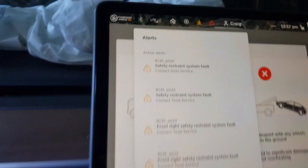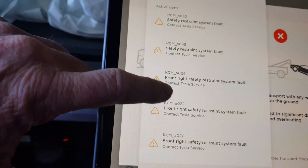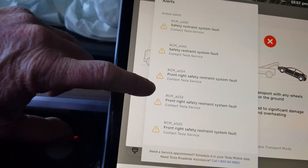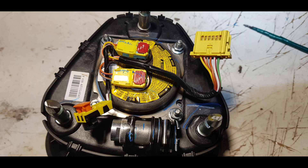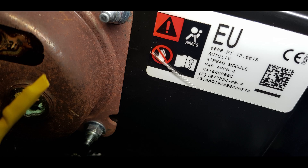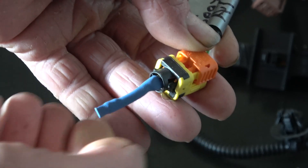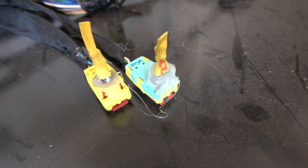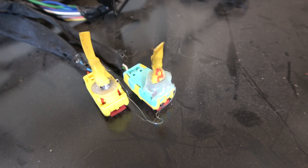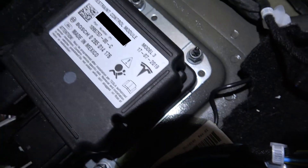The car is up and running, but because all the airbags have gone off, I'm getting a lot of RCM errors — restraints control module errors. After being deployed, the airbags show a different resistance over the contacts compared to when they're okay. So I need to emulate the original resistance back to the car. All that's needed is a 2.2 ohm resistor. After replacing all this, it solves all the errors other than one hard-coded error stored in the RCM module that needs to be programmed out.